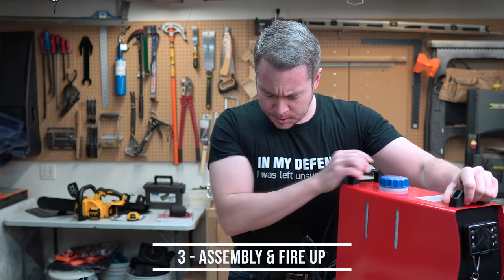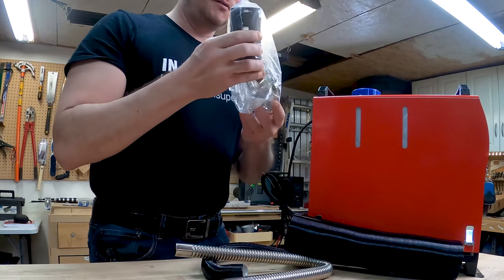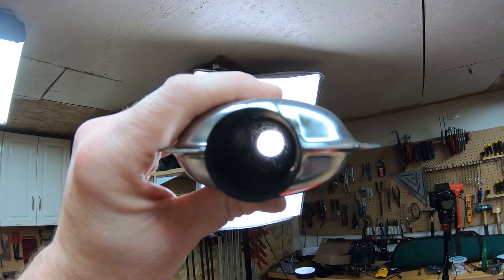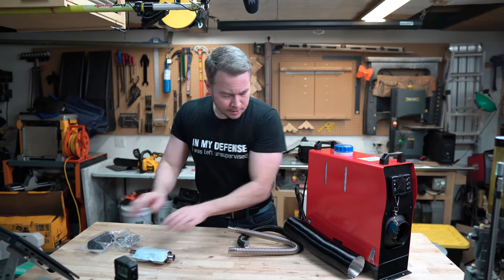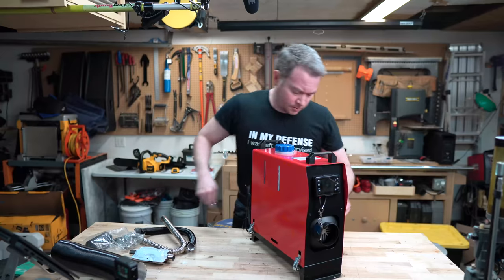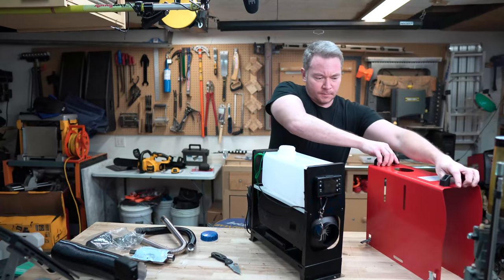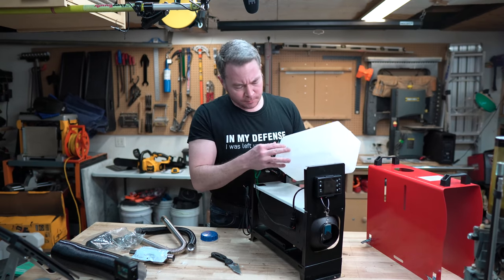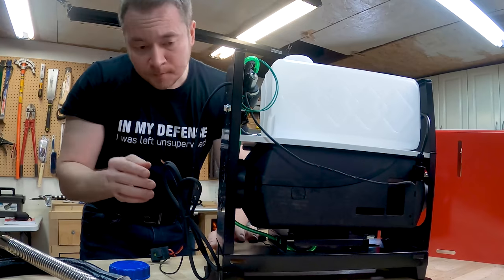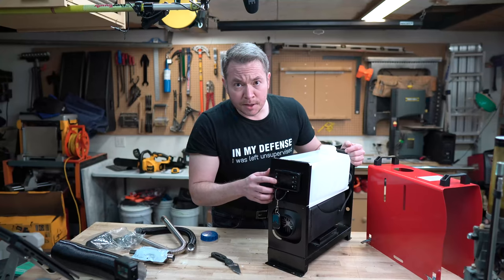Let's put this into the main unit. We've got an intake hose, an exhaust hose, a hot air vent hose, air filter and various clamps, and a pretty sad-looking muffler — this muffler doesn't even look like it does anything. Setting all this aside and taking apart the main unit, it's just got some clips. Take the cap off and remove the cover. We've got a gas tank that really isn't held in place by anything, a fuel pump with a short line from the tank going down to the motor, a blower motor to blow across the heat exchanger, the heat outlet itself, and an LCD panel of some type.